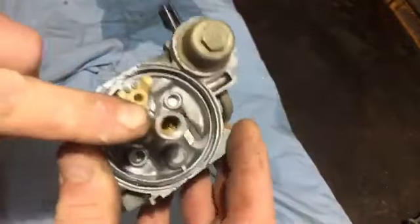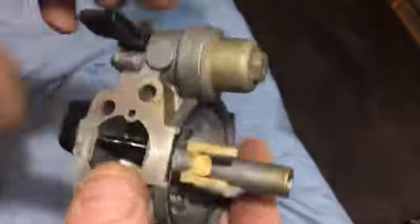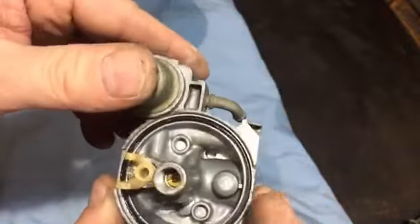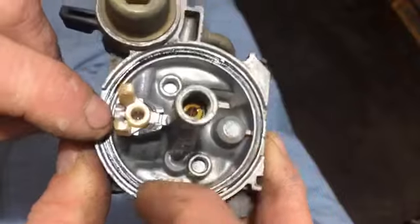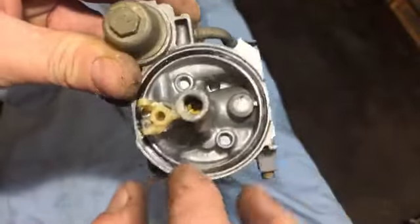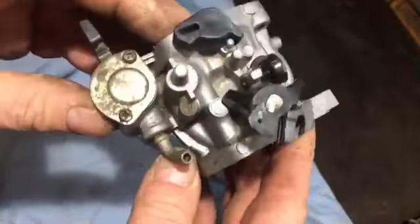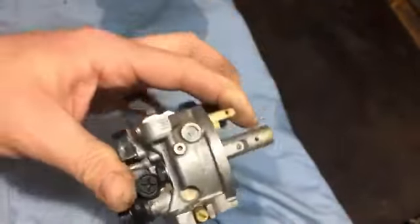And now I'm going to get the main jet out, then the tube above it, get that out, and I should probably take off that just to check if there's any gunk in there. The rubber ring has stayed in okay. Doesn't look like it wants to fall out, so I'm happy to use carb cleaner around this. I just won't overdo it around that area, but it's in there pretty well. I'm not going to pull it out because it might not seat so well afterwards, and I haven't got a new one. We've got that piece there to take out as well. So I might as well do that bit now, actually.